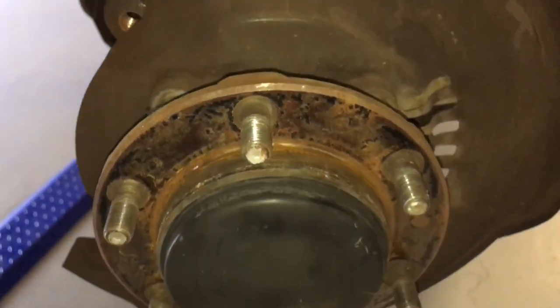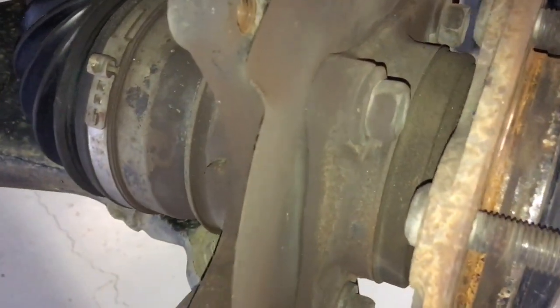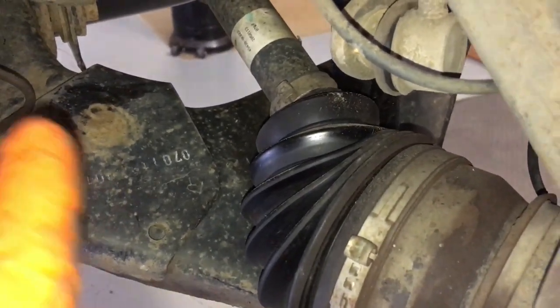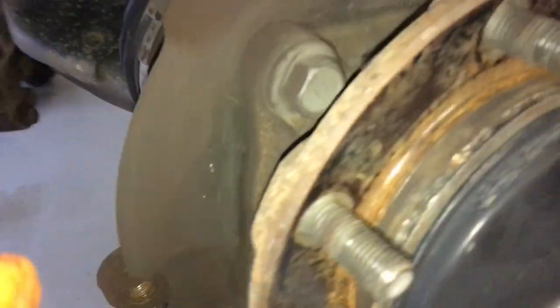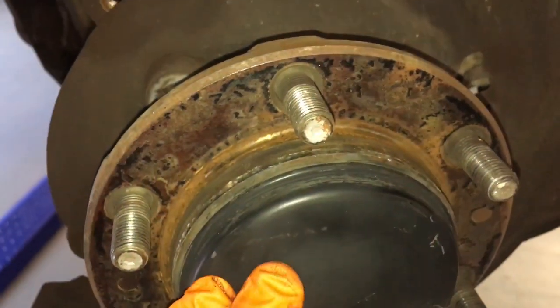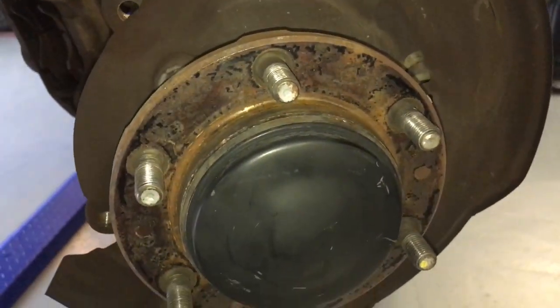Another good way to address run-out while you're at it is to change the wheel bearings, but we're not at that stage. We believe this is the original one. On the other side — if you've followed the videos on our Hilux — we changed the other side because it looked a bit butchered up, but this side looks very original. Control arm bushes look good, CVs look good, rack looks good. I don't think anyone's been in this side, which is why it's still good.